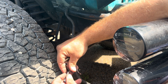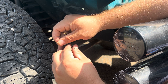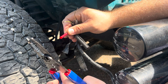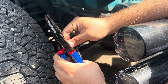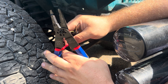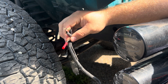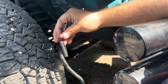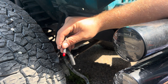Those other crimpers are kind of old — let me show you how it's actually supposed to work. Use these brand new ones that are in the kit and it just cuts right off just like it should. Put these bad boys on there. Now we've got three pieces of heat shrink. Slide that crimp terminal down on there and use the bottom of the pliers to crimp it. Make sure your wire's in there far enough, then squeeze her down so that it won't move. I realized I'm missing my heat shrink, so we'll put the heat shrink back on.